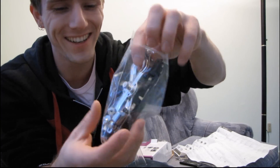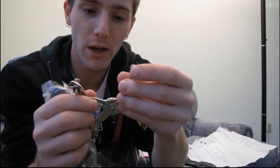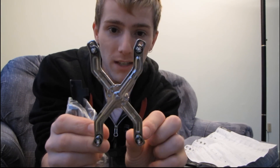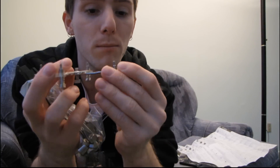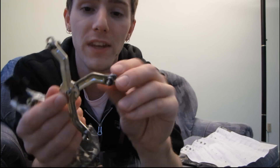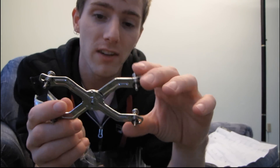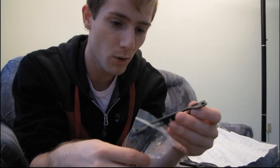Inside here we're going to find all of the other mounting hardware we need, including the hold-down for the front. You can see this is for AMD and that's for Intel. These can be moved back and forth and will actually move in and out depending which Intel socket you are using — 775, 1156, or 1366. Very ingenious hold-down.